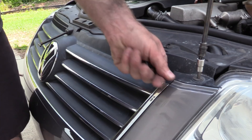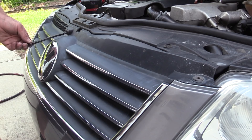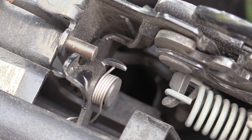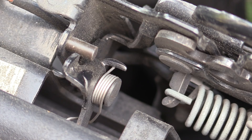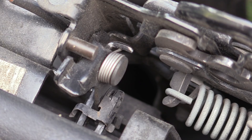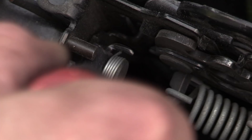Next, we're going to do the hood pull — this is the part where it usually breaks. The best way I've found is to push the hood latch back just a little bit, take your flat blade screwdriver, open it up just a little bit, and then push it all the way back as far as it'll go. And that almost all the time gets it. Now you can see we're installed — the alignment pins are in, and in fact the retention clip went ahead and snapped itself into place. Now when we pull the outer hood pull, we can open the hood.